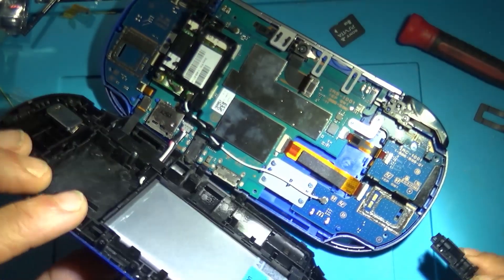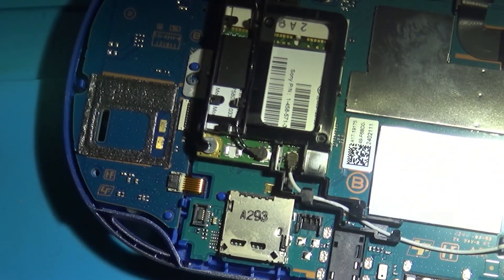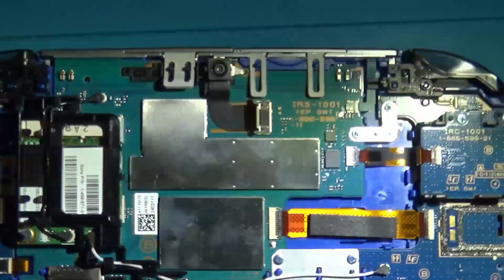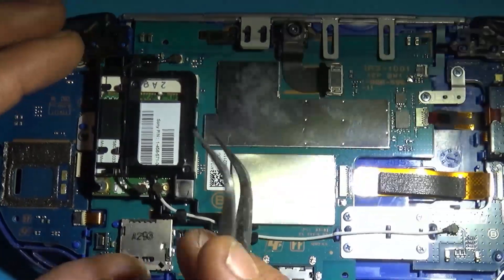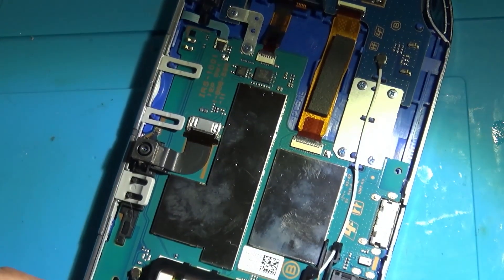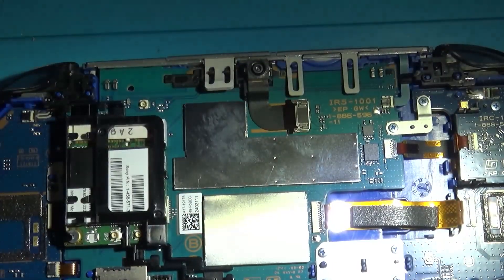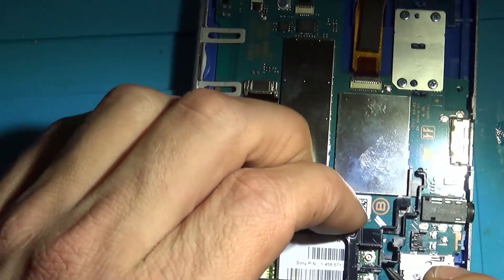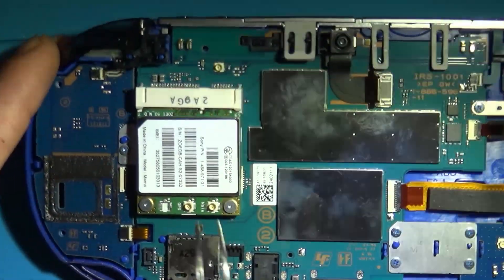Don't try to do it the other way. Come in with your tweezers and undo the ribbon cable and the battery terminal — simple as that. I'm going to be removing the 3G assembly there and replacing it. We've got to get rid of these antenna cables here; you will not be needing these, so keep them as spares or throw them away. Those are coming out completely, and the plastic just shimmies off — there are some clips on the side, simple enough.